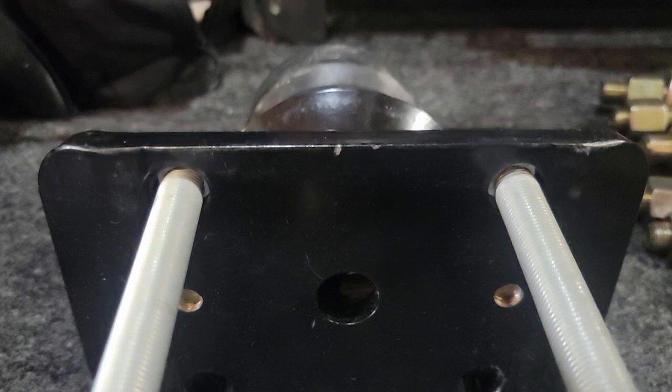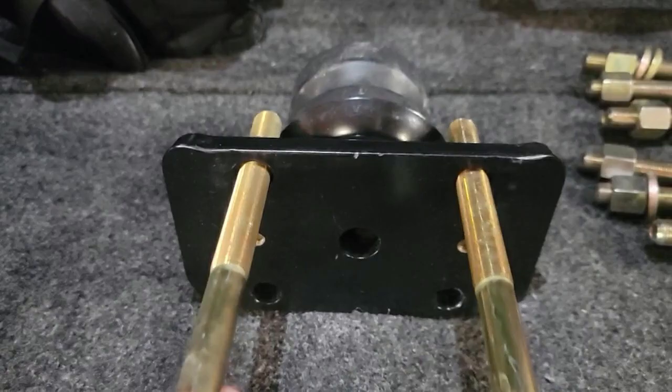As I was trying to source an adequate U-bolt, one of the things I noticed was that the supplied U-bolts are closer to an M12 or half-inch diameter U-bolt, and there's an ample amount of space in that plate. In trying to create a heavier duty product, I wanted to source a larger bolt. So I was looking for something that was an M14 or a 9/16, and actually I came across a friend who had the Timbren kit for a Tacoma, and Jason over at Rig Supply was able to pull that out of an old box as he was moving stuff around and give me a set of these as I was still waiting for my OME U-bolts, which are a little bit longer.